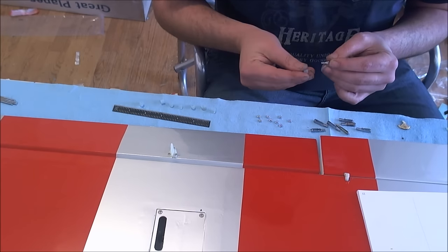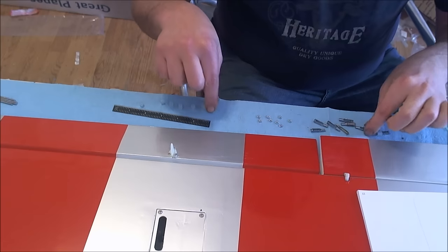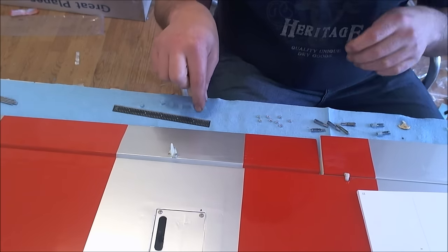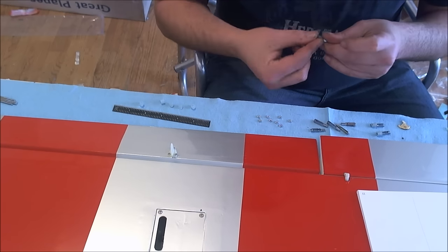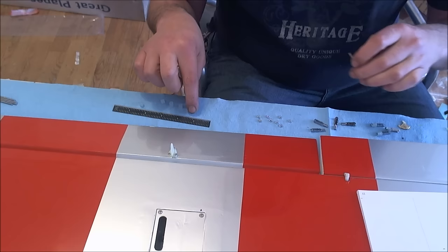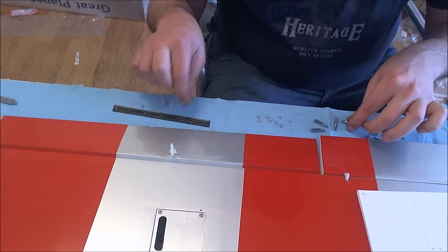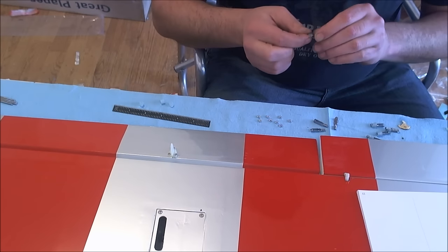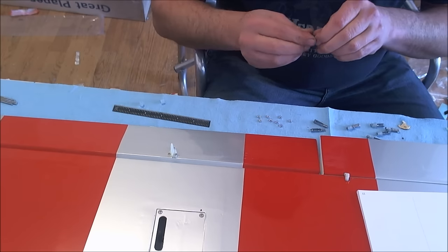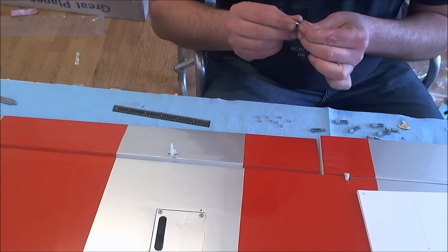Now, we have to have fuel tubing on here as a safety measure. So what I'm doing, I'm just going to go ahead and slide silicone fuel tubing, just the length, up on the barrel. None of this is solder like I thought, so that's kind of a good thing. We just want to make sure all our retainers stay tight. So we'll get all that. We'll slide this up over the clevis later.